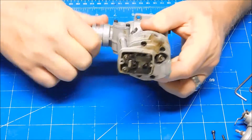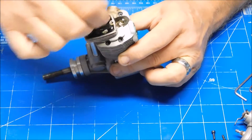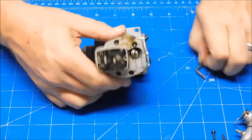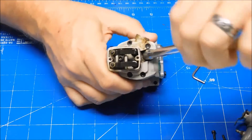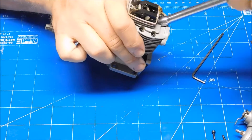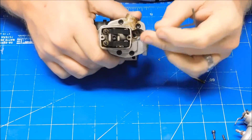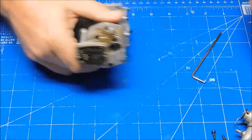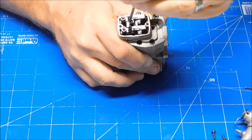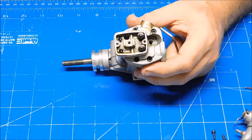What I want to do first here is rotate through and get to top dead center. I'm just feeling the valve lash — feels acceptable, I guess. I don't have my feeler gauge here, but it doesn't feel way out of the ordinary. All these fasteners are really gripping these wrenches, so that's what's kind of leading me to believe that maybe this thing's never been torn apart before.